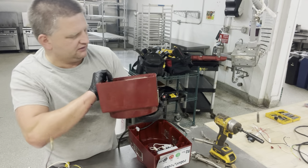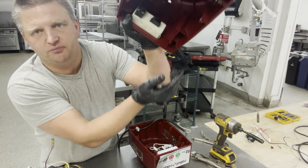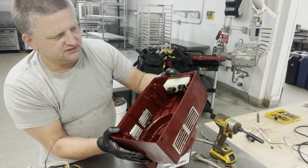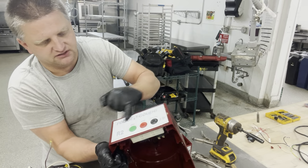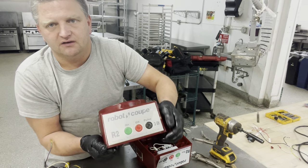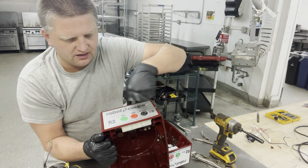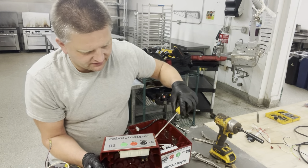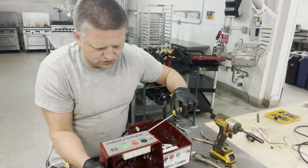I don't wanna mess with it right now, I don't have time. I wanna show you guys just how to put the motor back in and put the new housing back. Anyway, so as I say, in order to remove it, you remove the front plate, which is this piece of aluminum plate right here, by heating it up really, really well with the hair dryer and prying it out slowly with a screwdriver.